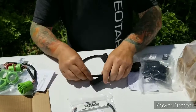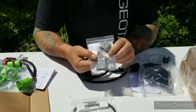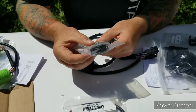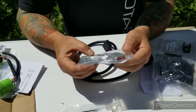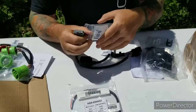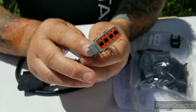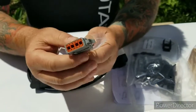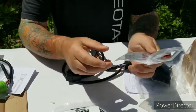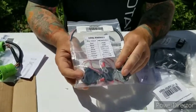Those of you that have ones with a Caterpillar motor or engine in it, you will receive this transfer cable for the Caterpillar engines. There are some of the groomers where under the seat there is a connector that looks exactly like that. Remember, don't use that one. It's already open, but it's not for us. It looks like this, but don't plug anything into it. You'll use our connector.